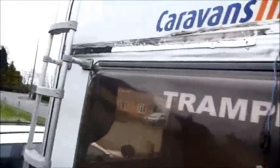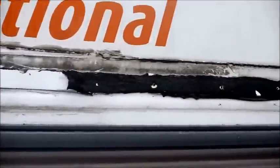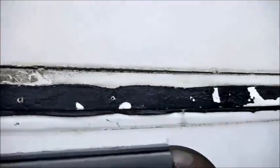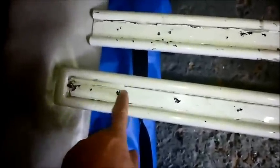We'll take all the trim off the back — I'll show you that. I'm going to get this mastic off. On the back of the motorhome was this little strip first, held in with two little screws at the end. I take them out, then pull the strip off. That revealed these two plastic pieces, starting from that end. Each one has a screw hole with screws, and the screws were rotten. Whether to put this back on or get some new trim, I don't know.